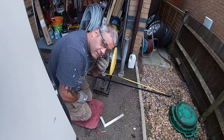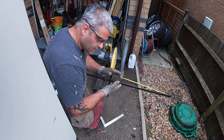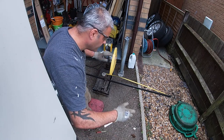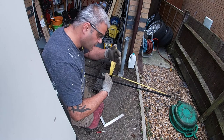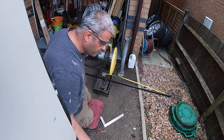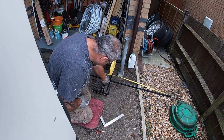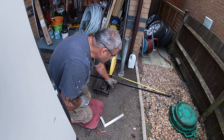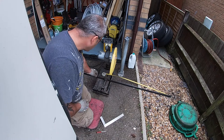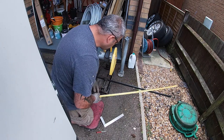Whenever you're cutting steel, glasses are a must — it creates lots of sparks — and I'll put gloves on for belts and braces when dealing with hot and sharp metal. I've measured the width of the window pod: I want 39 inches on the top rail, and the one that goes on the vertical face wants to be 44 inches. I'll go a bit longer so I can put an extra rivnut in either end for more structural strength. I've marked it at 39 inches — the 30mm bar — and on the vertical face I've got 40mm bar that's 8mm thick steel, so it should have quite a bit of structural strength.